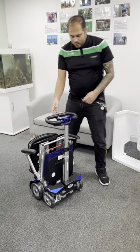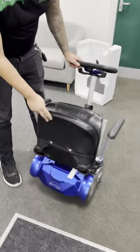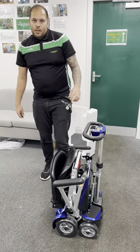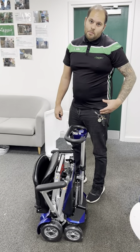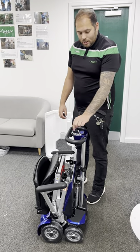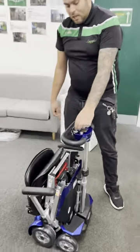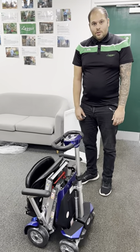One more thing: at the back of the scooter there is a freewheel lever — all scooters have one, and on this model it's on the left-hand side. If you push that red lever down, the scooter will beep continuously and be completely immobilized. To fix it, turn the key off, make sure the scooter is fully off, then bring that red lever back up towards the base of the scooter. Turn the key back on — you'll get just a single beep, no loud beeping — and then open your scooter and away you go.